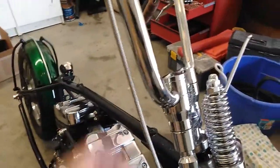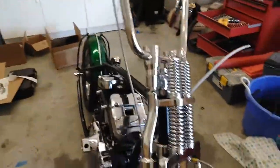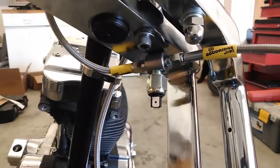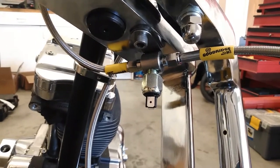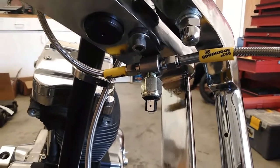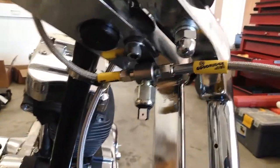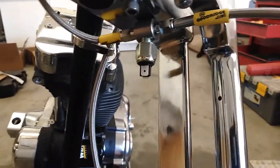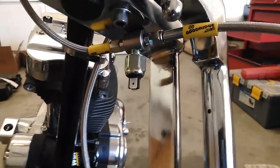See how the brake cables came out — this one here could probably stand to be an inch longer. It's not tight, but it would look a little better if it were flopping a little freer. I'll leave that for now. Down underneath here, that setup anchors the brake line so it's not flopping around, and that's the pressure switch for the rear brake light.